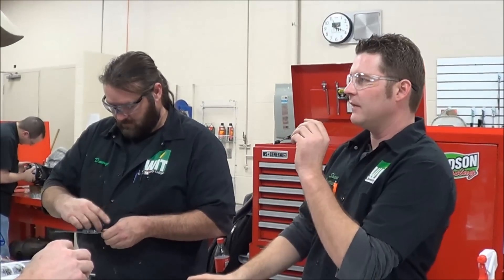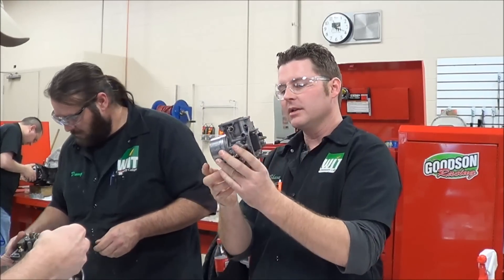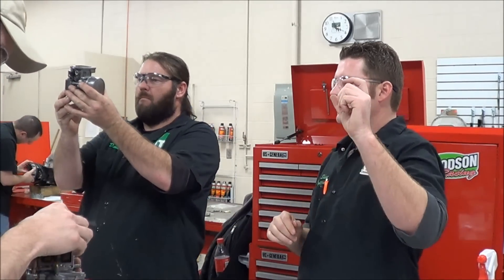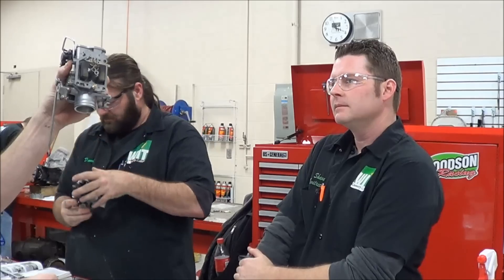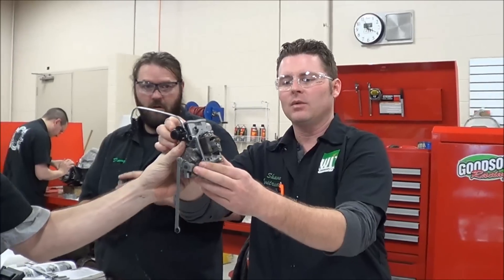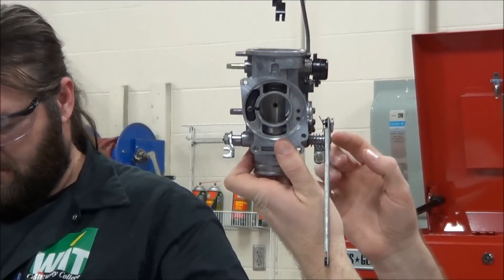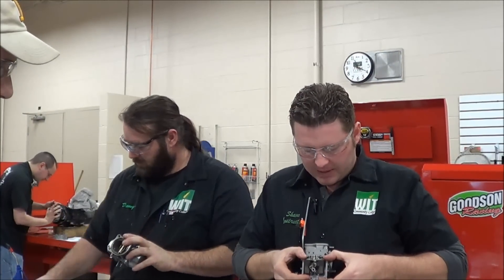Now let me ask you guys something — as far as being fast, if you can already tell that this is off, do you need to measure it? No. So what we want to do is get it where it visibly looks perfect, and then we get our tools out. Maybe the manual said to set that at a measurement that wasn't parallel, and then it would be more particular. Now, flip it — you've got a perfect point here of how it's crooked. When I'm looking at my side it is dramatic, and I can actually see the other float. What's happened is the float itself has been tweaked or bent a little bit.